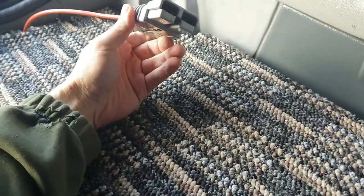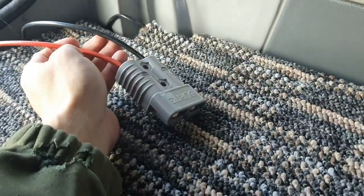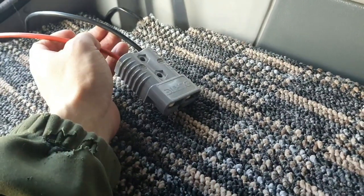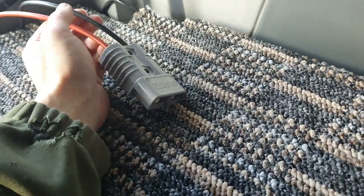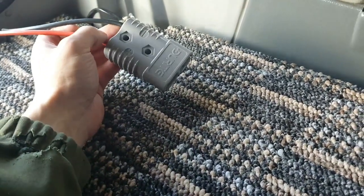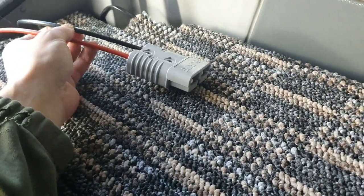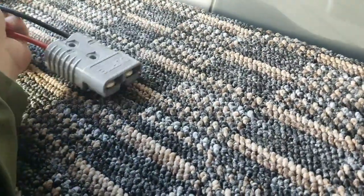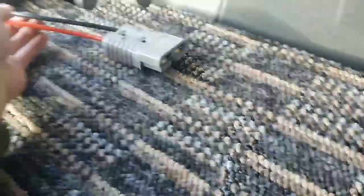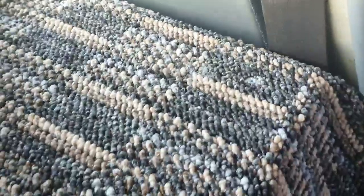What I'm debating on doing is also using this for the inverter. I've got another connection that will plug in there. This is 40 amp wiring, so 40 amps on the inverter is still about 2000 watts. I'm never going to be pulling three kilowatts out of it - I'm just going to be using it for my little heater and doing a couple of other things. So I should not have a problem pulling any power out of the inverter using these wires. I can always keep an eye on it if it gets too warm - I think it's only going to get warm if I'm pulling three kilowatts for a longer period of time. So we're going to get that inverter hooked up in here, and that means I can still use the little heater that I had at the bottom for the winter months because it does get pretty cold.